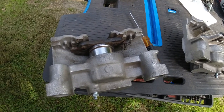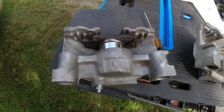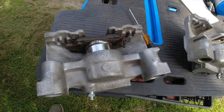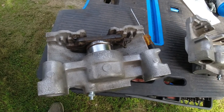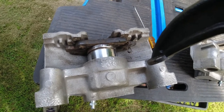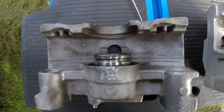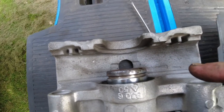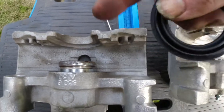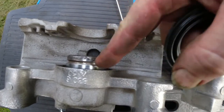This is actually a completely different caliper — I had the opportunity to pass on this bit of knowledge here. When you're installing the dust shield, you want to start at the back and work your way to the front, but also when you're pressing in the piston, don't press it the entire way. That makes it easier to get the lip of the dust seal onto this groove right here. Leave the piston just a little bit proud, so you don't have to squish the dust shield down into the groove — you can work the shield around and then push the piston in more afterward.